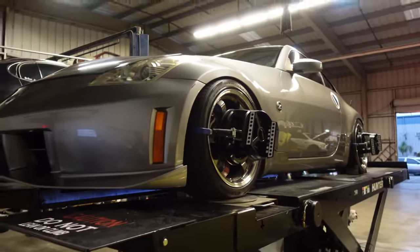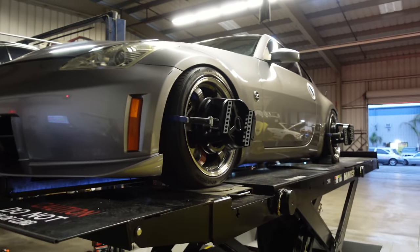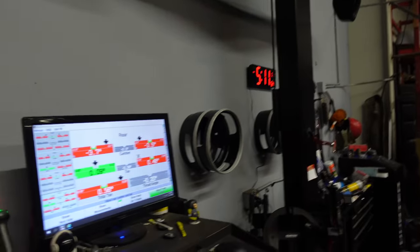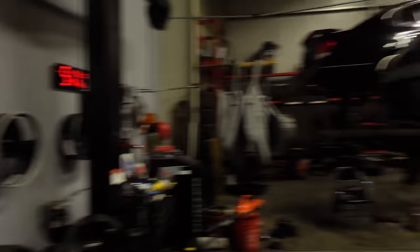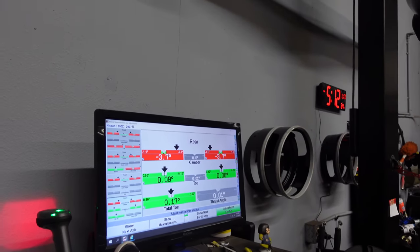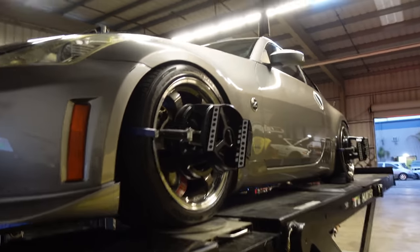With these coilovers there's not really much we can do about the camber unless I really just raise it all the way and try to get the camber out naturally. Even if I get arms I have to change the coils to get it to like zero or negative one. He actually had to give it a little camber just so the toe is correct — we had 3.7 degrees which is all bad for drifting, but it is what it is.